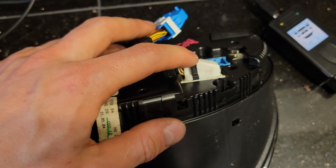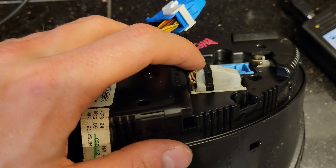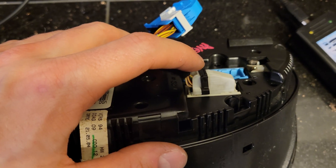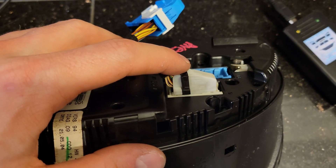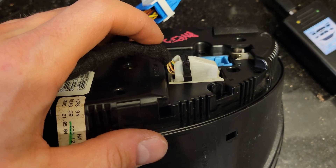On the white connector you're going to need six pins. Pin 1 is for the K-line and you only need it if you want to connect it to the computer — if not, you don't need it. Pins 9 and 10 are for ground, and pins 12, 15 and 16 are for power.